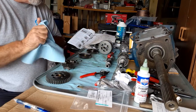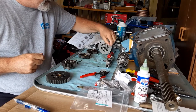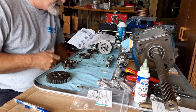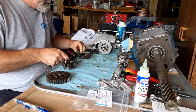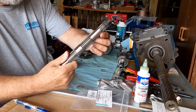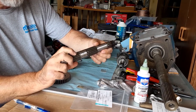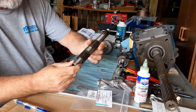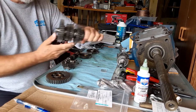As soon as I get a chance. First we have to finish up our output shaft. Luckily I have this other transmission so I can show you the disassembly and inspection. Here is my original output shaft assembly, which I think is going to be the one I use because it's cleaner around where the output pulley goes to the rear wheel. The other one shows some rust and corrosion, and the wear patterns on the shaft are actually lighter on mine.